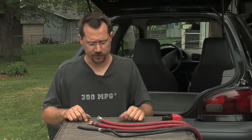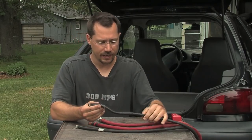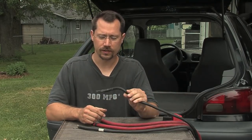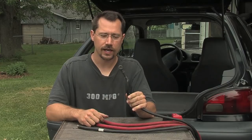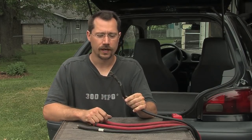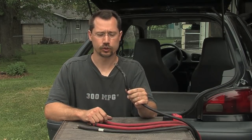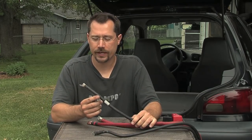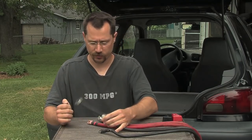In the examples I have in front of me here, we have a two gauge cable. This is pulled off of a forklift. It has a flat lug at the end of it and already has some non-conductive shrink wrap tubing on it. A little bit bigger is a one gauge battery cable, also just stripped off of a forklift. It has a simple side lug on there, doesn't have any heat shrink on it.